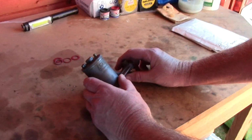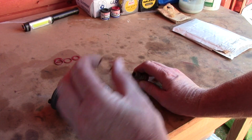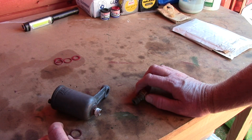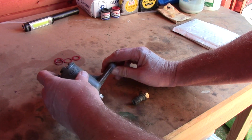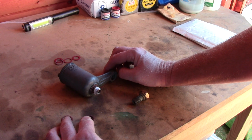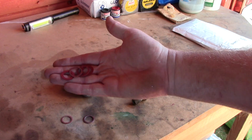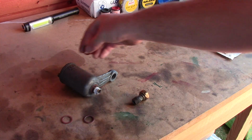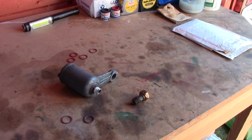So I've taken off the float bowl, and as I spoke of, the fibre washers, you can see those. There are I think 3 or 4 in total on the float bowl setup. There's one there, yeah, so there's 3 on here. Replacements have been sourced. These are from Stationary Engine Parts. I'll put a link in the description. They're pretty good for all Lister D type stuff, but they do a lot of other stationary engine components and consumables, and they've helped me a lot really with this restoration.